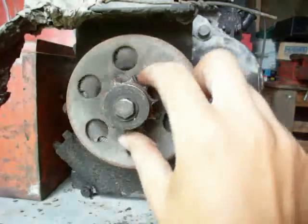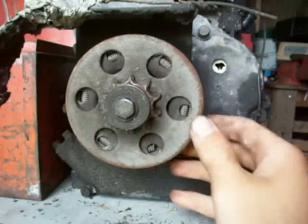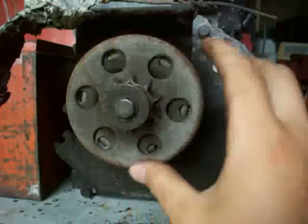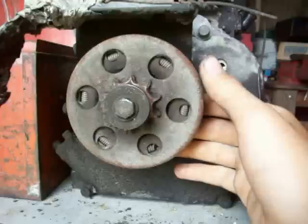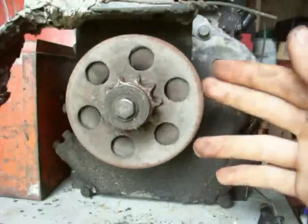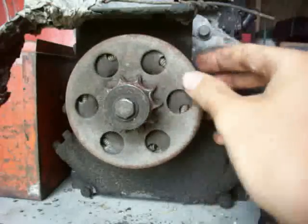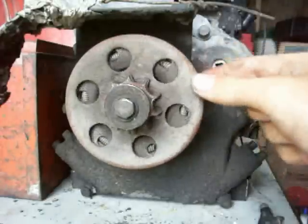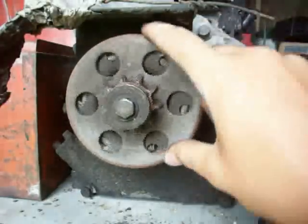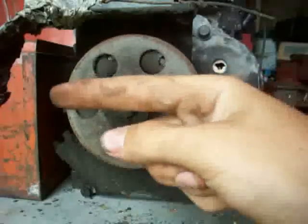This video covers centrifugal clutches. Centrifugal clutches are driven by centrifugal force. The springs you see in there expand outward when engine RPMs go above a certain point, usually about 800-900 RPMs. When they engage, they will rub on the underside of this piece right here and cause the outer shell to move, driving the teeth to make your go-kart go forward.